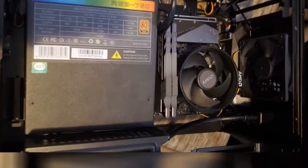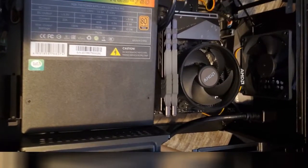I've included a photo of a full-sized ATX PSU and you'll notice the clearance for the GPU is blocked and it does not rest or sit flush in that slot as it passes beyond the lower metal tab. Only use an SFX or small form factor PSU.